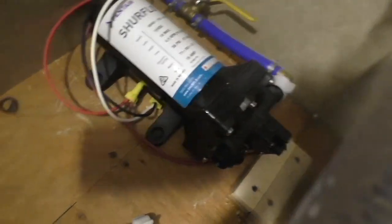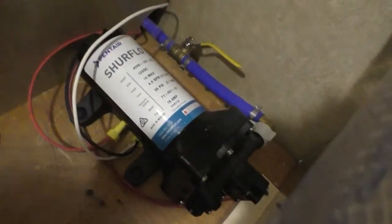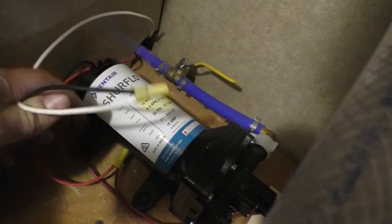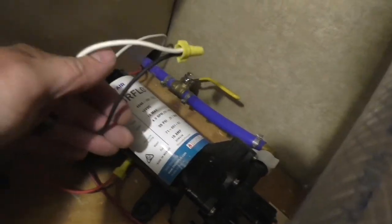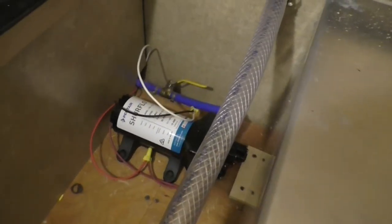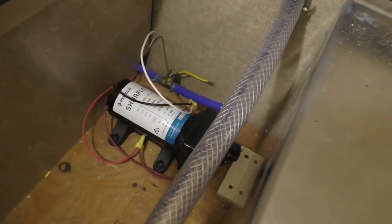In the event that you're replacing a pump, you leave this on, take this one off, take this one off. These wire nuts — you just twist them on there, and you want to match your colors. For example, coming out of the pump, the black goes to your white wire, and then red to red. It's a DC pump, which is to say it's a 12-volt pump, and you want to make sure you get those hooked up right so it'll run.